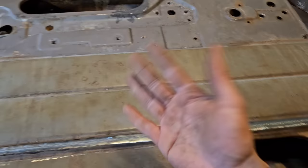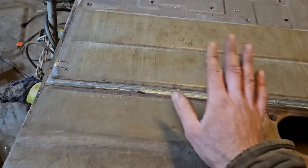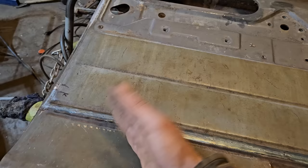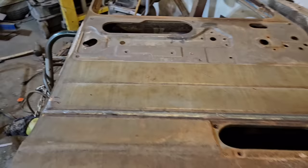this inner door. I think I mentioned already, but this is getting a full interior panel, probably down to like here or so. So all of this part will be covered. Nice thing about the TIG weld is this is all flat enough that we don't even have to grind it. We can just leave it. We don't have to do anything with it, because like I said, it's getting an interior panel over it. Obviously we got to finish out the edges a little better, but that's a problem for another day. Just good to get this all solid and back in one piece again.